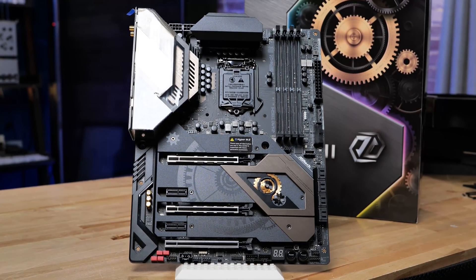Let's take a look at the physical layout of the board. First up, you notice you have three physical by-16 slots. This isn't a lot different than Z370, Z390, Z270, Z170 — not a lot has really changed on the chipset side of the equation. This motherboard is a new socket though: Socket LGA 1200, a new socket designed to deliver a lot of power.